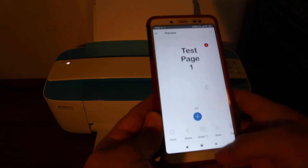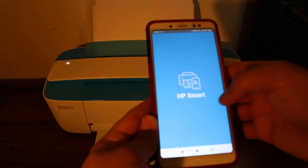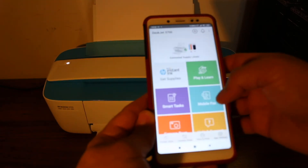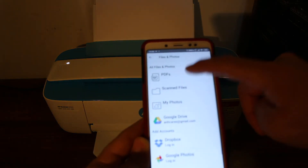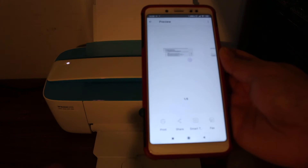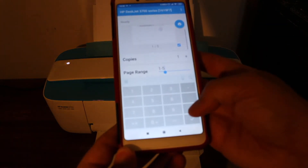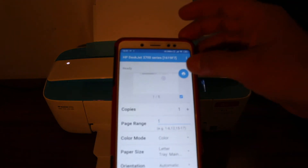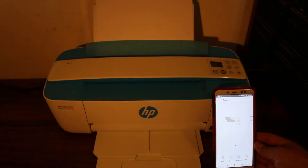When you click Next, you can click the plus button to add more copies. Now I'll show you how to do wireless printing. Go to the main screen of the app and look for the 'Print Document' section. Open the document you want to print, select the page range and number of copies, click the blue icon at the top, and wait for the printer to print.